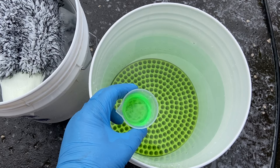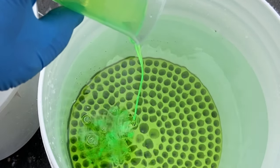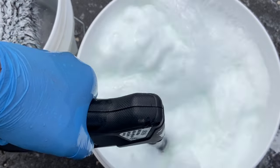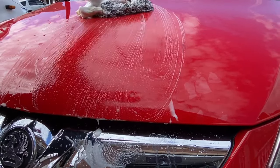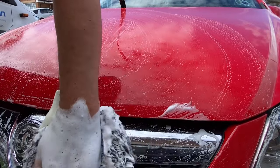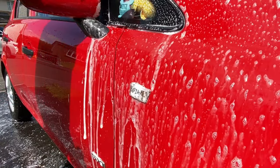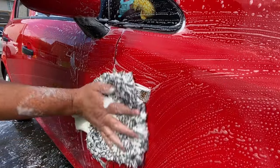Jelly bean scented, highly concentrated, pH-neutral car wash shampoo. There's definitely a theme of luminous green with these products. Instructions say to add 25 to 45 millilitres into a 25-litre bucket, which is great as hard water areas need a little more than soft water areas. I added 30ml and honestly felt that was too much — the suds were a little overpowering. So for this shampoo, just adding a glug isn't advised. Best to measure using the cap, which holds around 5ml. It's certainly one of the better shampoos I've tried.